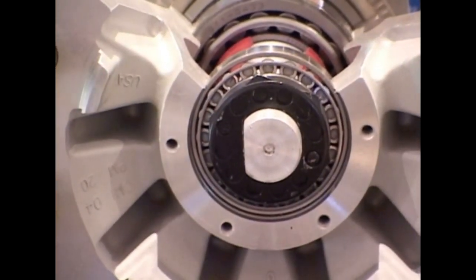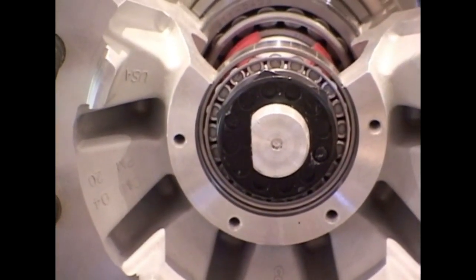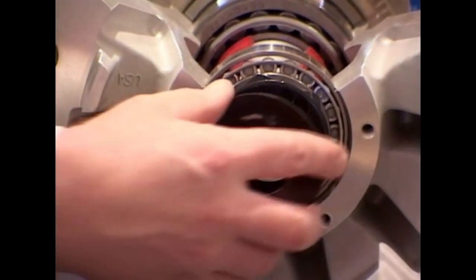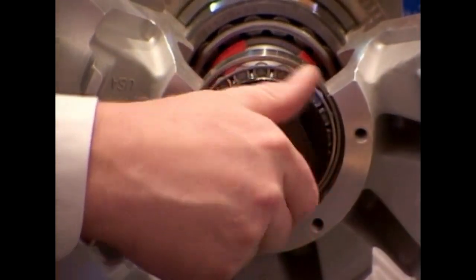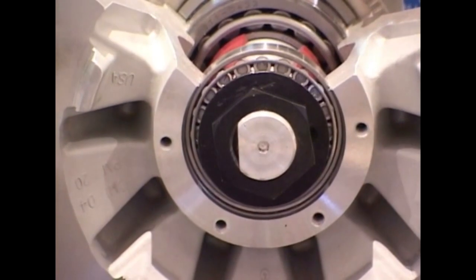In the event it doesn't fit, we only want to torque the spindle nut — no back-off, contrary to manual adjustment procedures. We want to ensure that we've got 300 foot-pounds minimum torque. We put the locking device on and torque the outer spindle nut to 200 foot-pounds. When that torque is achieved, we activate the locking mechanism on the nut system.